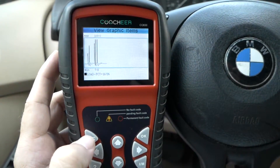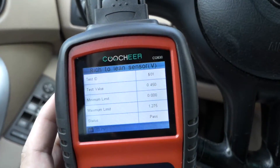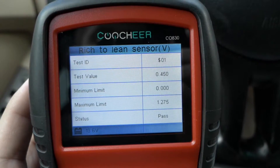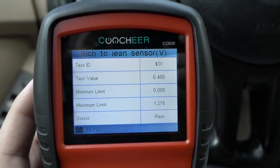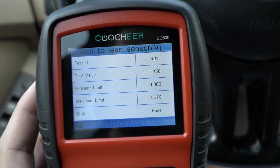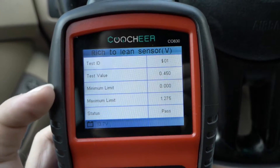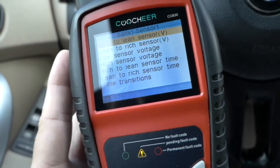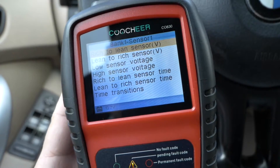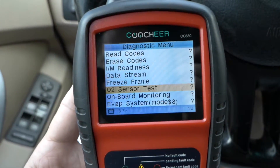I'm genuinely impressed. Let's see if we can do the O2 sensor test. It's passed. So you can actually, before you write off everything as fine, check your O2 sensors — because O2 sensors could be very tricky. So it passed. It goes through the voltage test: rich to lean, lean to rich, low voltage, high voltage. This thing really goes into detail for the basic things.